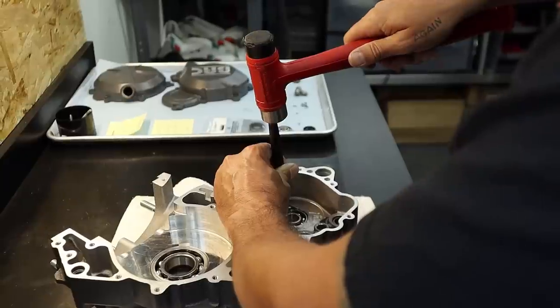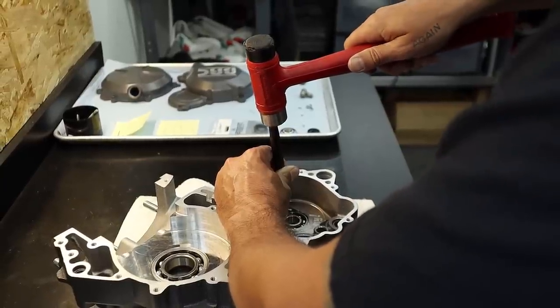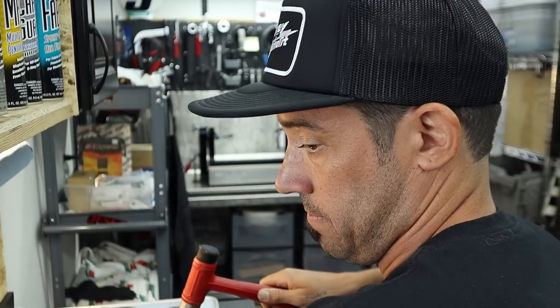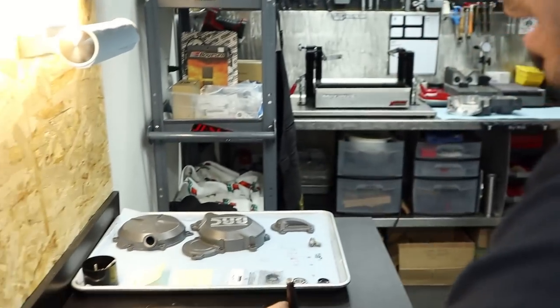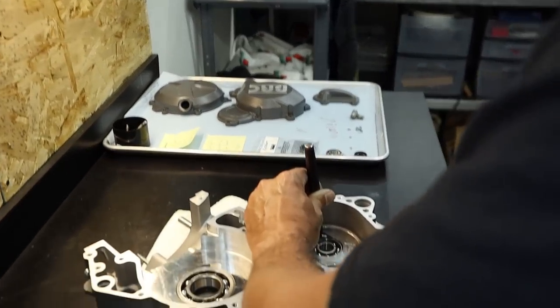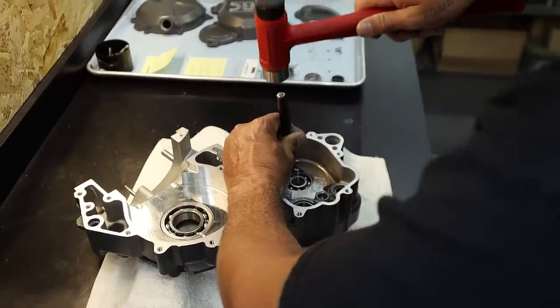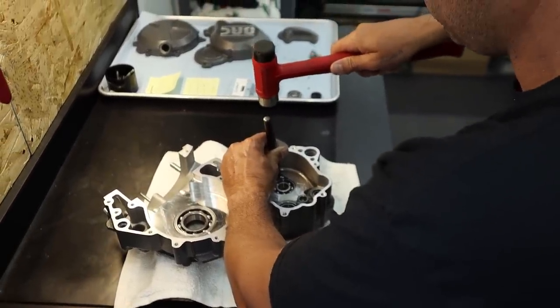Right. But you also don't want to break the screw loose. You do it with the Loctite, the stuck nuts, wet. Because you don't want to do it after it solidifies, later on, don't give it too much time. After it solids up, you'll break it free. Always do it with the thread locker wet.